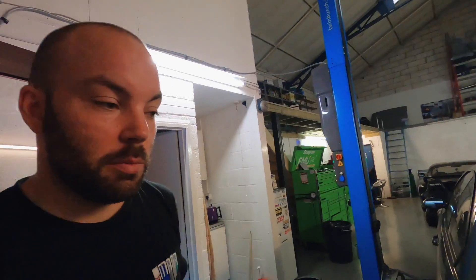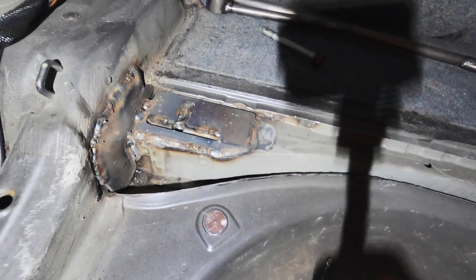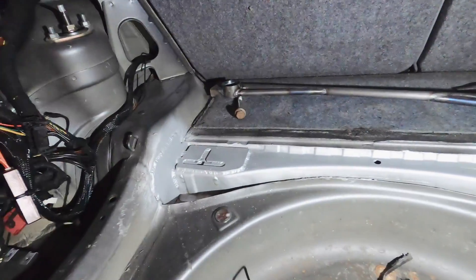The bolts are out now and we're going to chase the threads and put the long bolts in. I've had the welder out — bear in mind it's not the best MIG welder and these welds aren't cleaned up yet, I've literally just finished. Here's what we've got: one side plate, other side plate, base plate — I've got a stitch around both of them and a plug weld in the middle. I'm pretty happy with it — it's not going to fall off, and I didn't set fire to the car, so we're all good. It's hot and muggy; this is not a job for this time of year. The guide that Chris supplies with it is very good — I've followed it step by step. I've put some weld-through primer on the affected areas and then I'm going to drop the brace on top. Cleaned all the spatter off — we're getting there, another job ticked off the list for the E46.